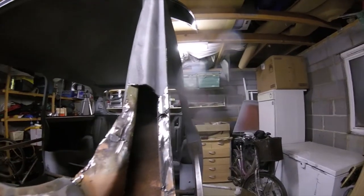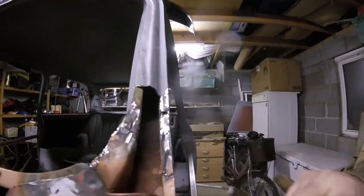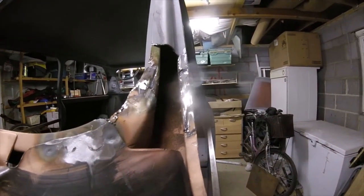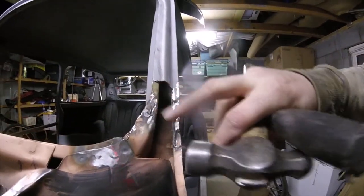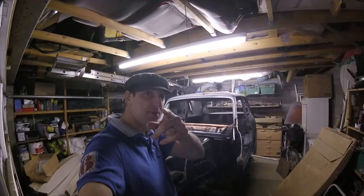It's hard to get underneath this piece — there seems to be a lot of spot welds, can't make them out on this side. It doesn't seem to want to release anywhere along this length, so we'll just grind it off — no problem. This piece has come off alright, it just tore out a spot weld there, probably slightly rusty, but that's fine. Once it's in we'll pop a little bit of weld on the back and just fill that up.